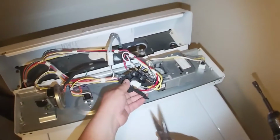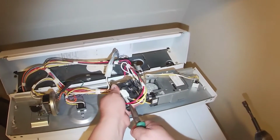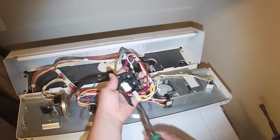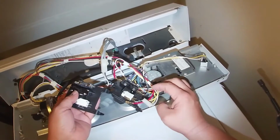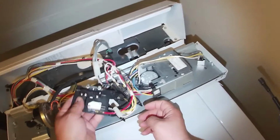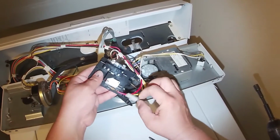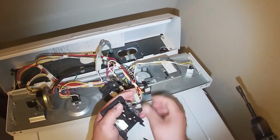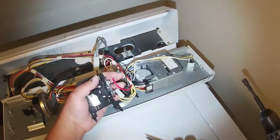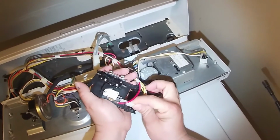And then after you remove the 5/16 screw, you can get the whole switch assembly out. And then we're gonna start removing cables. Remember to take a picture before you start removing wires, to know where the wires were before you remove them from the old switch. However, what I do is I put one switch right next to the other one. When you remove these terminals from the old switch, sometimes they expand, they open up. So I clip them back, that way they're tight in place.